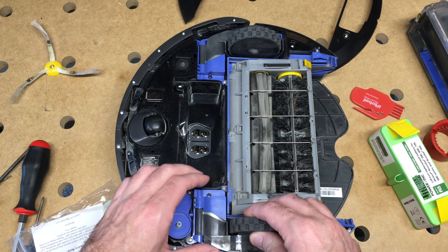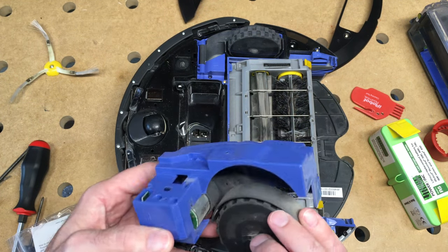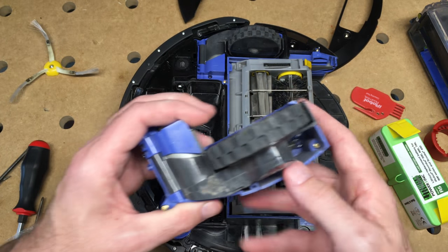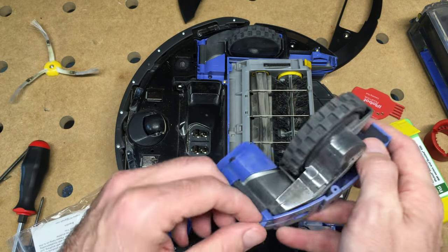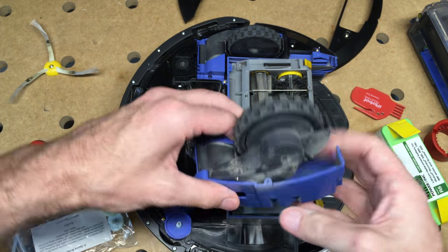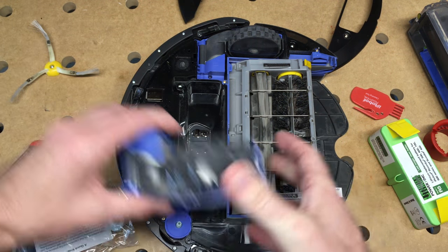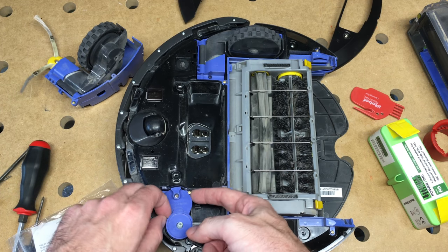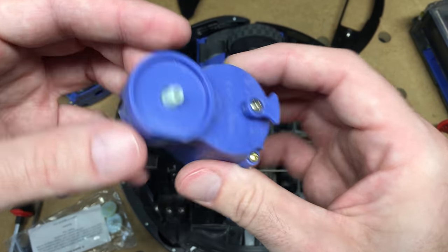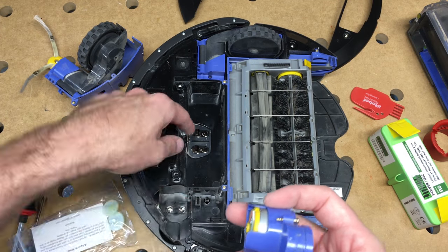So the gear is stripped, which is what prompted this repair. You take out three screws — there's a screw here, a screw here, and a screw here. They're more or less captive; they shouldn't fall out very easily. And you can order this replacement if this breaks. Then there's two screws here for this gear that hold it in, and these all just plug right into a little socket so they have spring terminals.